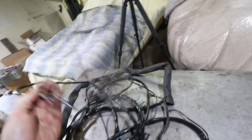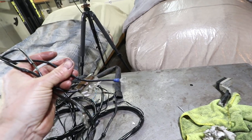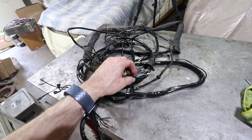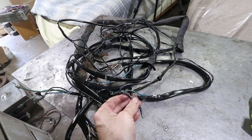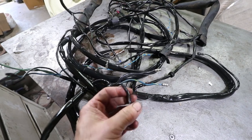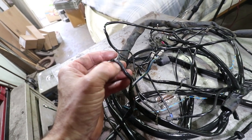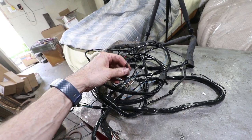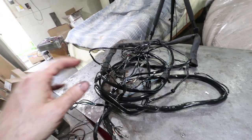There are lots of breaks in the sleeving right here — two or three breaks. There's a little burn mark right there in the engine bay, and that terminal is not right. The piece that connects to the ignition switch has a black-white wire that goes directly to the engine coil — that's an important wire. This insulation has been burned or compromised; you can see a little bit of copper right there, a split in it. It's gotten really too hot, burned the wire at some point. This is an unfused wire that goes to the ignition coil, so this wire needs to be replaced. I'm not going to run my car with something as important as the ignition coil on a wire that's been burnt and is unfused.